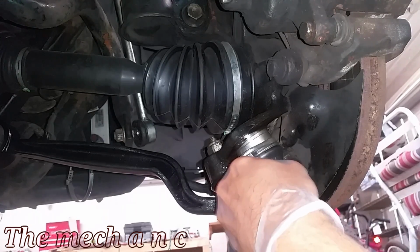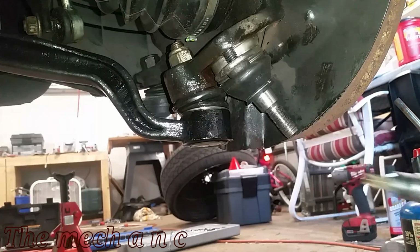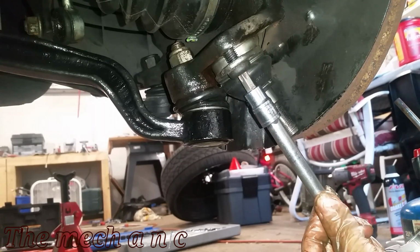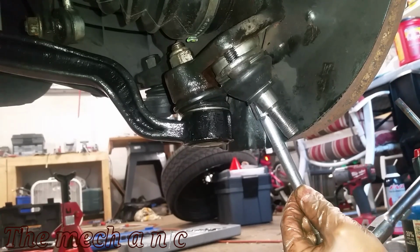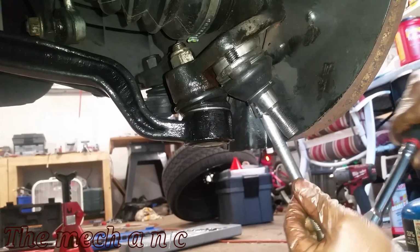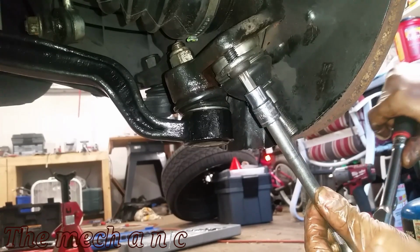Another big tip is to try to get it in its correct orientation the first time, meaning the two tabs on the sides, or the ears, make sure that they're lined up with the bolt holes so you can run the fasteners in. Because once this thing starts to get pressed in even a little bit, there really isn't much wiggle room to rotate it once it's inside of the bore. So before you even start, make sure everything is aligned properly before you start pressing it in.